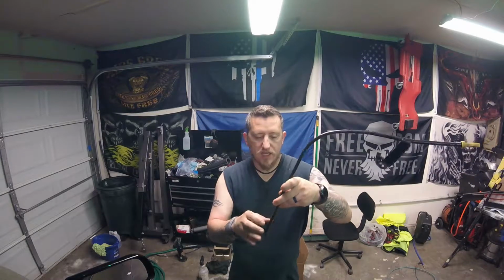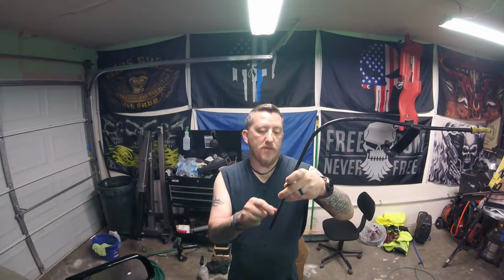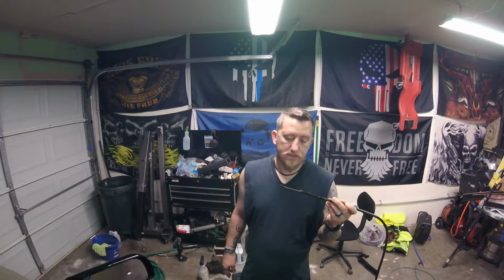is, you know, with the oil moving and I really get on it, the oil's probably getting super hot, so it's probably coming up the dipstick and then just spraying out, and then it hits on my headers. And that's what's causing that white smoke look, because it's on the passenger side, and this is the only thing on the passenger side. So hopefully this will resolve the white smoke issue.